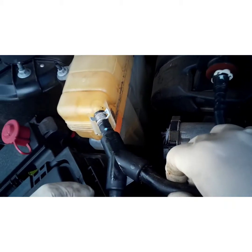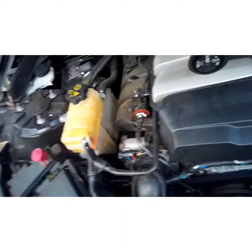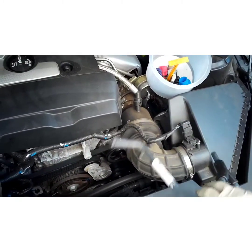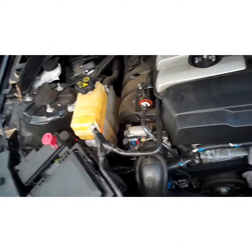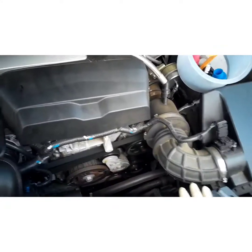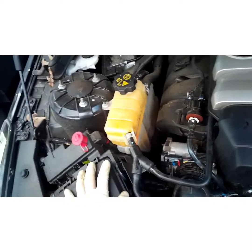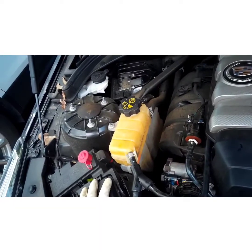Personally I think they should have made this hose out of metal, but that costs too much to manufacture — and they can't sell parts that way either. Fortunately this part is only about $25 and it's readily available. I got this one from Napa; they keep them in stock and it's a genuine GM part. If you can't get it from your local parts store you can always call the dealership — they'll charge a little more, but you have to do it because overheating the engine is a lot more expensive than a rubber hose. This one will probably last about 30 or 40,000 miles as well.